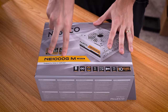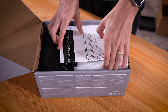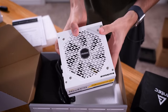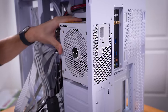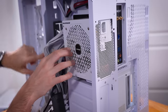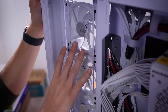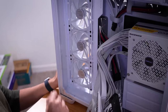And finally, the NeoEco NE1000GM in white — the M standing for what I assume to be modular. A thousand watts is a bit more than we need, but it doesn't really hurt. These white power supplies are pretty rare in the wild, and boy do they look good. I'm actually upset we're not going to be able to see this from the left or front panels. Get it situated fan side out — remember that right panel is totally perforated, so this will get plenty of air. We get white cables with this PSU, which is quite nice even though we'll be using extensions. This here is an air duct partition — it separates the air being pushed out by the side fans from the remainder of the system, so you have cable management on one side and an isolated air channel on the other. I think that's really clever.